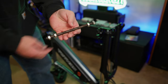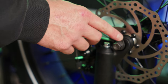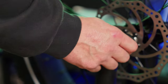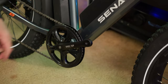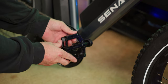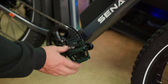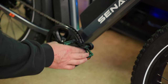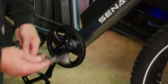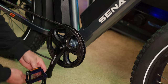Take out this axle that comes in there — it's put in place so the fork does not bend during shipping. The washer on top has a little tab that needs to go within the gap in the dropout. The pedals are specific to each side of the bike, so start screwing gently and get the right one. The pedal on the other side is reverse threaded. The nice thing is the included tools are typically the exact sizes you need for the install.